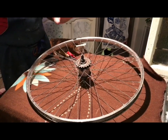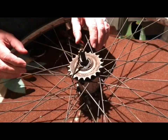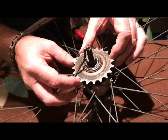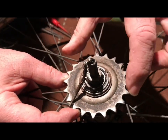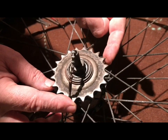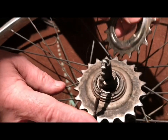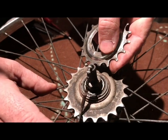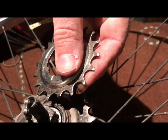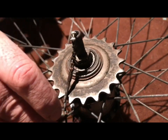On this occasion I'm replacing a worn sprocket. I'll show you how worn the teeth are - when the teeth on the sprocket come to a point like that, it is too worn. A good set of teeth should have a flat or a curve on the top; you can even see the machining on this nearly new sprocket. When they start to get to points, it's time to change - your chain will start to jump under load.